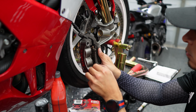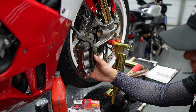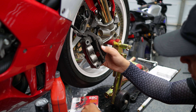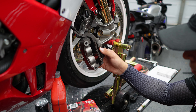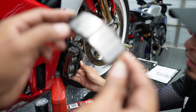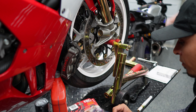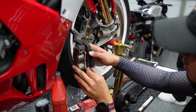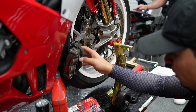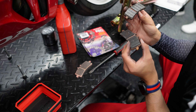Each caliper is a little different — this one looks like it has a clip, kind of like a guide clip. Let me check the back. Every pad is a little different, but you shouldn't have to deal too much with that silver piece. Pop one side up, slide the other side out. You can see these are old pads — I think you still have another 10,000 miles on these in my opinion, but we're changing them anyway.